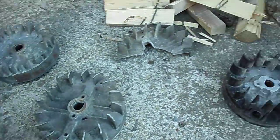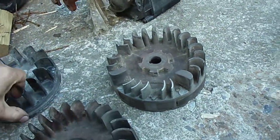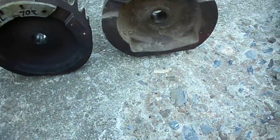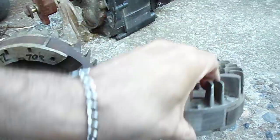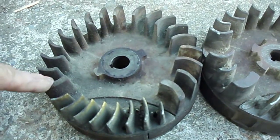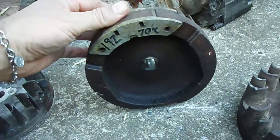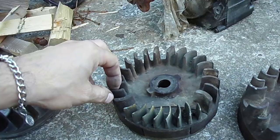Getting back to the heavy flywheels off a rototiller motor - something that doesn't have a blade on it, or it could be a riding mower. We've got the old one and the new one. The new one will fire the newer magnetos, and the old one won't. They're probably similar weights. The old one has two thick fins, this one's got thick fins but not nearly as thick. This is what I run on my lawn mowers when I start them up without a blade for safety reasons - so you need the heavy flywheel so they run nice and smooth.